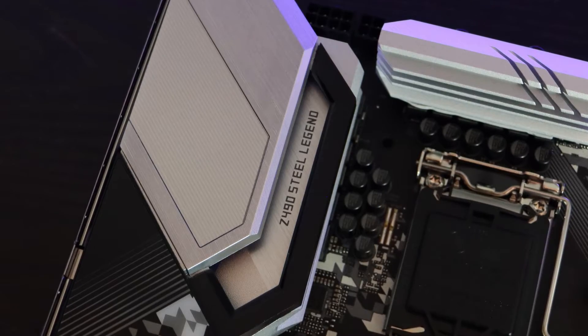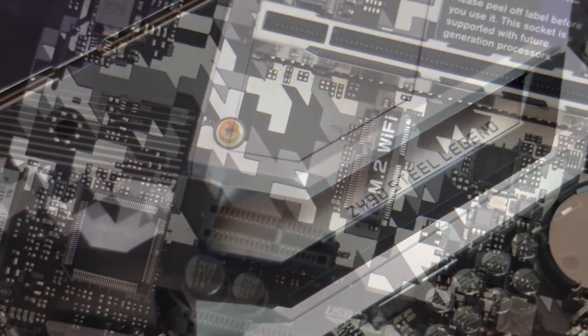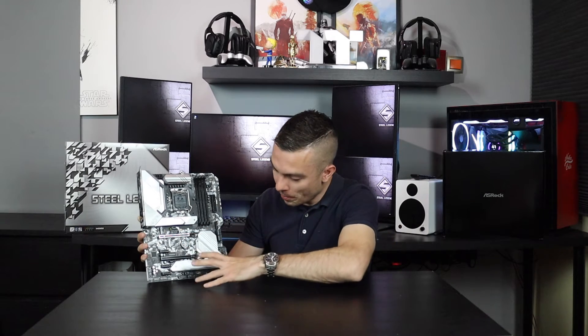Checking the IO shield connectors, they could have added two more USB ports next to the LAN port or above the USB 3.2, which would make seven USB ports total — since five ports quickly fill up with mouse, keyboard, headset, and maybe a USB storage device. That said, I do love all the Steel Legend designs, even the lower-end models. They've packed in a lot of connectivity very tightly: seven PWM fan connections, RGB headers, everything is nicely arranged for easy cable management.